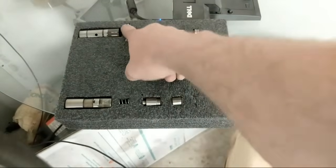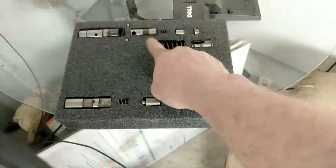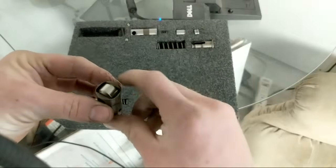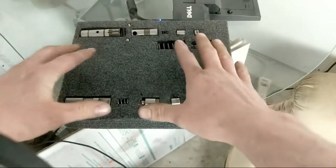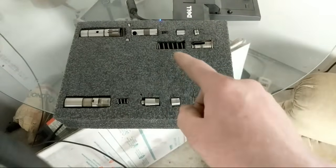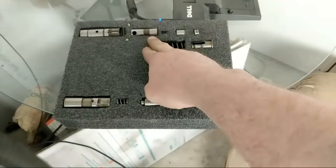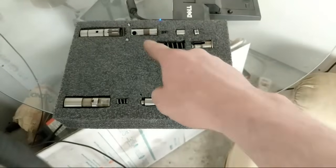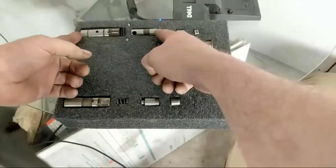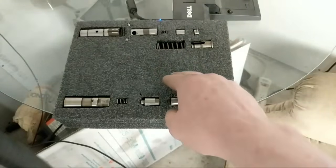By taking this apart and measuring, I found that from the push rod area to the base circle of the roller there is approximately a 400-thousandths difference in length between these two lifters. That means you can't put this lifter in that hole because the push rod length is too long — it leaves the valves open. This one has a longer range than the other, and there's also a different base circle on the cam. I want to figure out exactly what that base circle difference is.